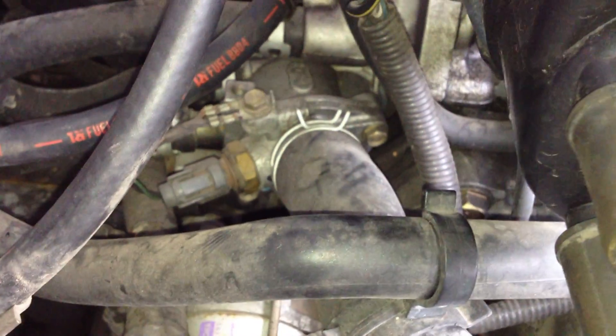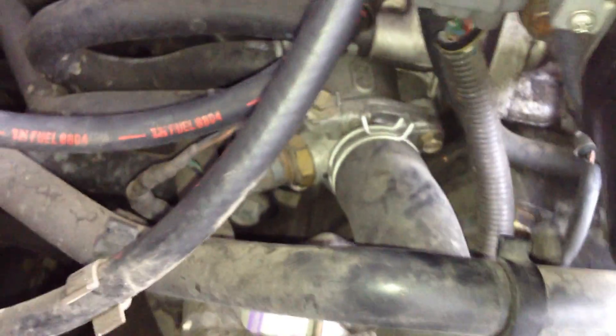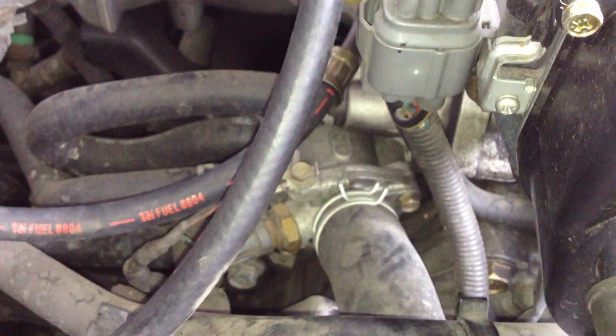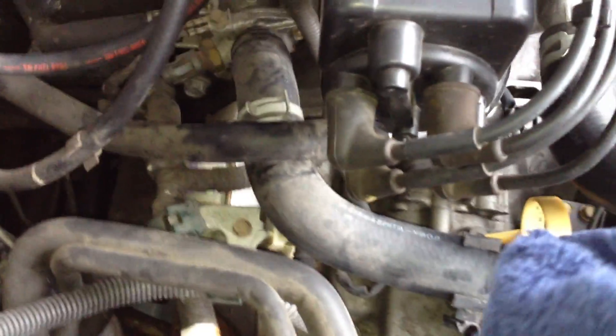There's a clip on this hose that we'll have to take off. You can drain your radiator and then replace the fluid after you're done. What I'm probably just going to try is picking this up and holding it above the radiator so I don't really have to worry about refilling all the fluids. You should do this when your engine is cold so you don't have hot radiator fluid going everywhere. Once I pull this off I'm obviously going to drain some fluid, so I've put a drain pan underneath to catch that. I've got the clamp off and I've got a towel to put over the end of the hose so I don't leak fluid everywhere, and then I'll sit it upright somewhere so I can get in there.